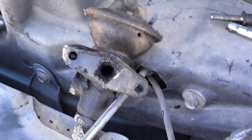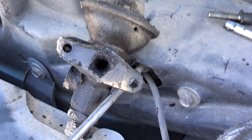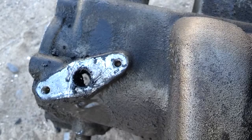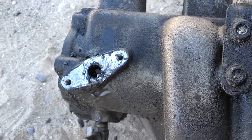That's how it looks with some of that stuff broken out. That hole in the middle is bigger than the screw holes on either side, and the same goes for the hole on the intake manifold. Make sure you get all that carbon knocked out of there and that buildup, so that your EGR system can breathe good.